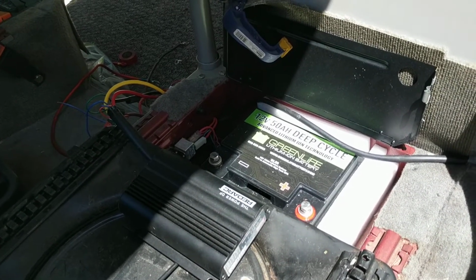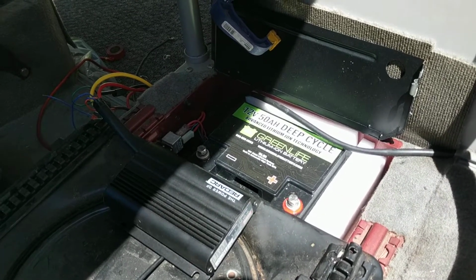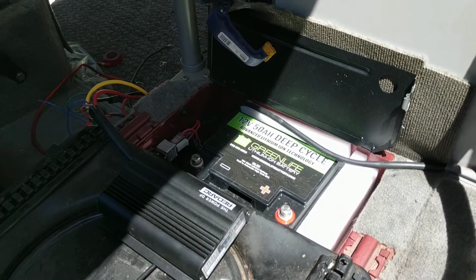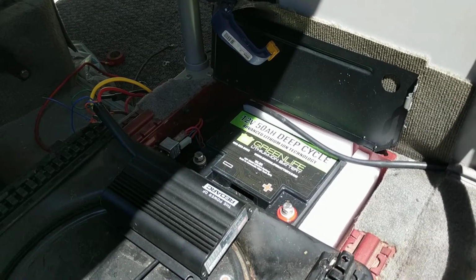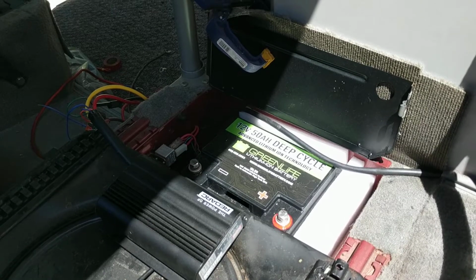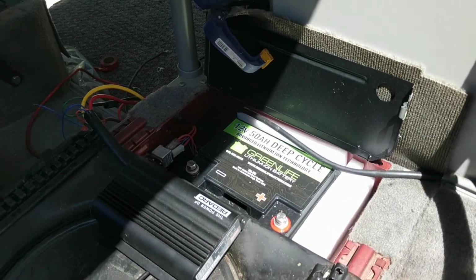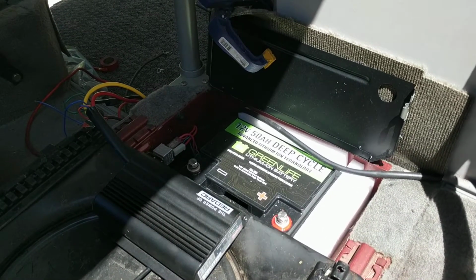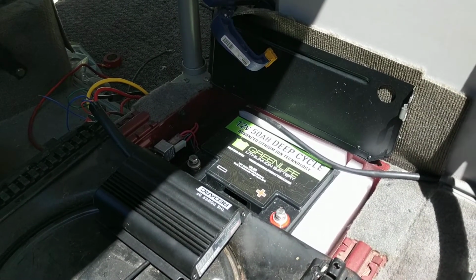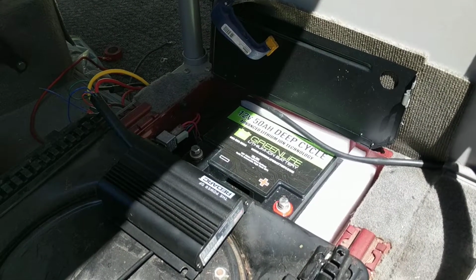Also your cycles. With a lead acid battery, the most cycles you're going to see out of that is like 1,000. These, it's anywhere between 5 and 10,000. So that means one set of batteries, if it lasts for a year or 2 years and only has a few hundred cycles, this one you're looking at a possible 10-year lifespan. That is a big, huge plus as well.